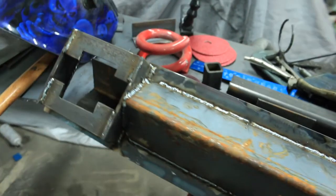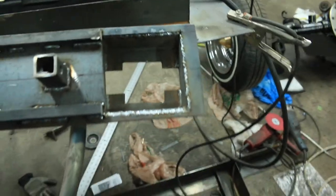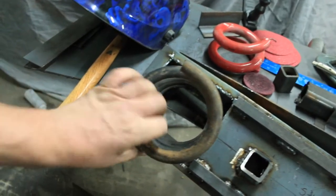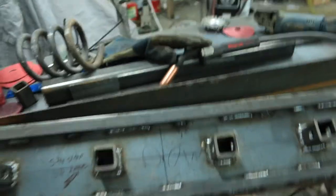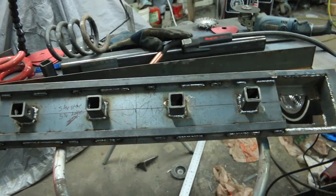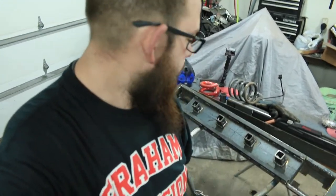This is the back side of the bridge - you want to actually see this when it's up in the car. Let me flip this big sucker over. Oh my god, that thing is hefty. That's going to be the side facing down. So these are going to be the pockets for the springs and cylinders. And then I've got some options for where I'm going to run my chain, so I'll be able to figure out what spot I like. Two of them will never get used once I figure out what spot works best, but at least I'll be able to adjust it without having to get up underneath there and weld up another tab. So that'll be nice.